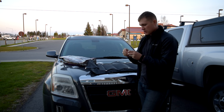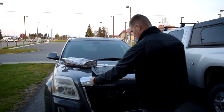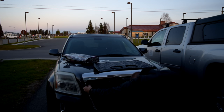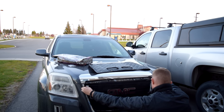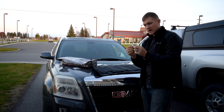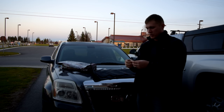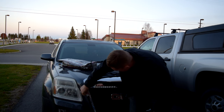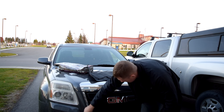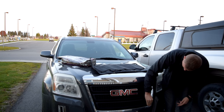Now that we have the snaps on there, take your alcohol swab. If you're not sure where the snaps are going to be, you can flip the screen upside down and place it on your car so you can see approximately where it's going to fit. Ours is going to fit right there, following the trim piece. This swab does fold over, so I like to take one side and use it — it gives us maximum usage. Go ahead and start cleaning. It really behooves you to clean this as well as you can before you apply the adhesive.